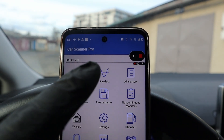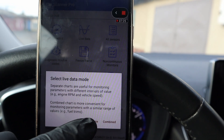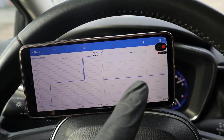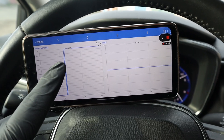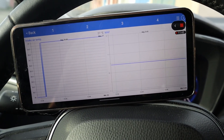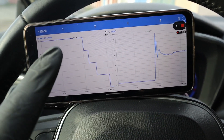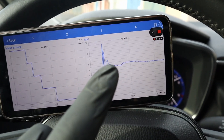The app will also let you look at live data graphs — data from your engine. Let me select separate mode: intake air temperature and also mass airflow rate. So when I turn on the engine, we should see more air coming in, so this graph should go up and temperature decreasing, so this should go down. Let's try it — press on the pedal. See, we have more air coming in. This went up nicely and also temperature went down.